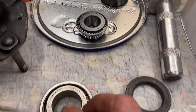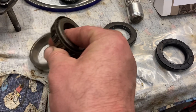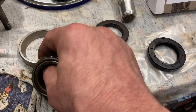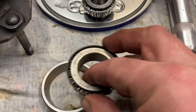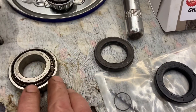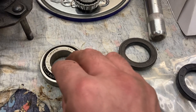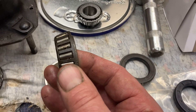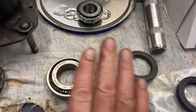Here's what a tapered roller bearing looks like in the race. There's the race — you'll have to hammer that in first. It's got a taper to accept the taper of the bearing, and it fits in there nice and smoothly. The benefit to these is they're completely serviceable: you can take the hubs off, remove the bearing, clean it, repack it with grease, and put it back on the car. No problems.